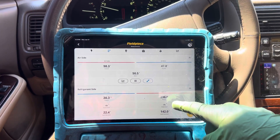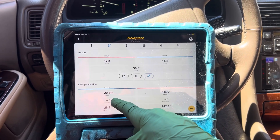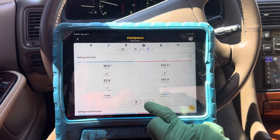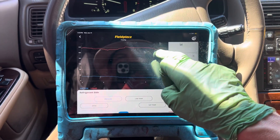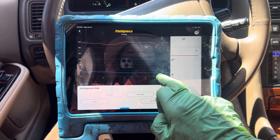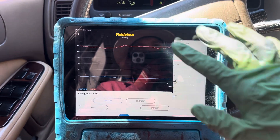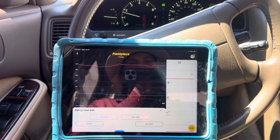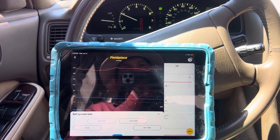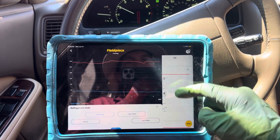Can you see that on the screen? What's happening to the high side? What's happening to the low side? Let's go up to 2,000 RPMs — let's get some graphics. You can see where I touched the throttle right there, a little dip, a little dimple. Let's get it out of the shade so you can see it. Now let's go up to 2,000 RPMs — come on. There we go, 2,000 RPMs. What's happening here to the low side and high side?